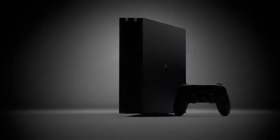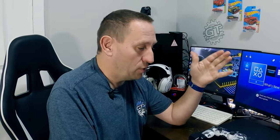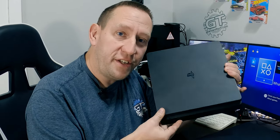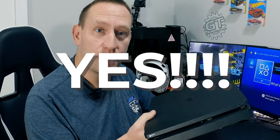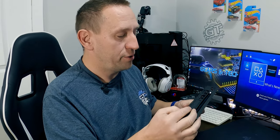It will load into games just as fast as your PlayStation 5, or maybe just a little bit slower — not much. This system is now rock stable and will last you for quite a few more years before you really need to upgrade. For those with a PlayStation 4 Slim or the original fat PlayStation 4, the process is exactly the same. On the Slim, just slide the cover over and the hard drive is right there. You can use the same USB stick to load the software, just like we did on the Pro.